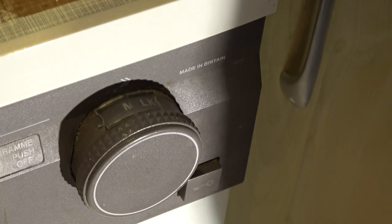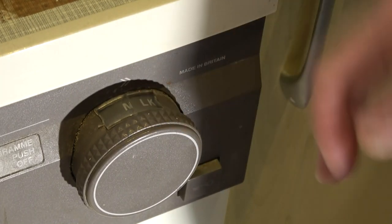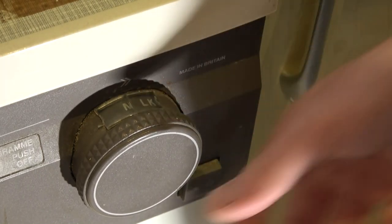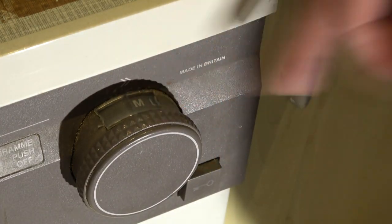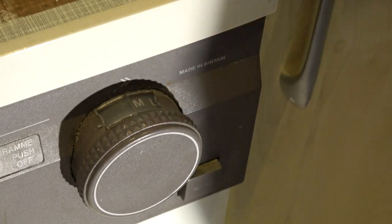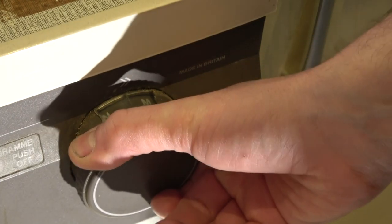The white nylon and minimum iron both wash at a low level, but the delicates program, program 40, uses a high level. Actually, what it does, it reaches here, and the moment it reaches here, it advances to there, to do cool down. If it adjusts that program M, it will actually heat to 40 first, before it gets to this point, and then it will do a wash, before finally draining and doing three rinses.